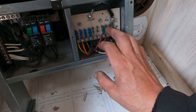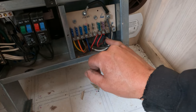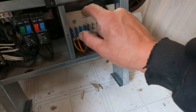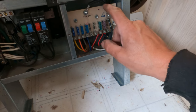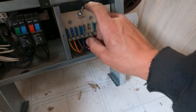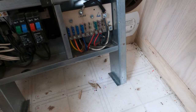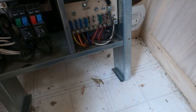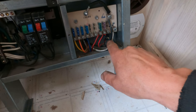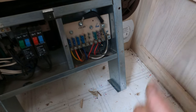What I've done is jumpered all my fuses now so they're powered by power coming in from the battery. This is the power coming from my battery bank — I've jumpered it with a piece of white wire from the old converter and put some black heat shrink on it so we know they're both black power wires. Everything's powered now by power coming in from the batteries since the converter isn't powering anything anymore. We just have power and ground coming from the battery bank.